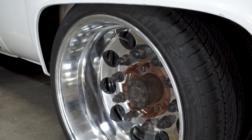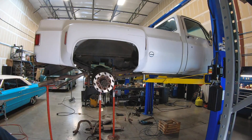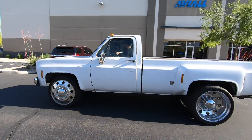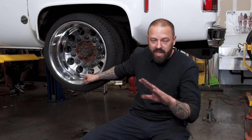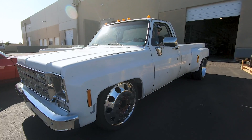What it is, is we're using a nine-inch wide steer wheel on the back outer - that offset allows us, with the machining we do on the inside wheel, to suck it up perfectly. I thought maybe one of the wheels was more narrow, but you can't tell after you machine them. We start off with an Alcoa wheel - we prefer Alcoa or Accuride because of the quality. It's kind of like Nike versus Payless. The Alcoa wheels are substantially lighter than your off-brand Gemsy wheels, and the polish also comes out a lot easier.